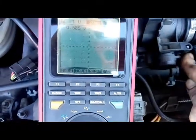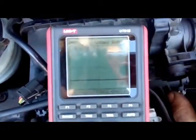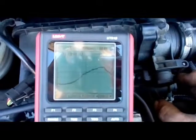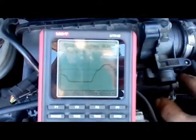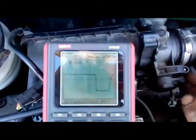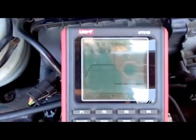I can change my time scale — I've changed it to half a second per division. So now when I snap the throttle open and let it drop, you can see it catching up on screen. Another thing to do is quickly snap it open and quickly drop it to see if the voltage falls below the baseline. That's another test to check everything is okay.